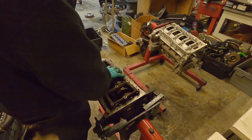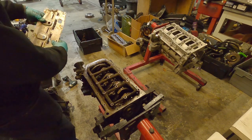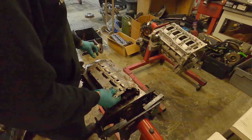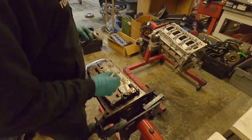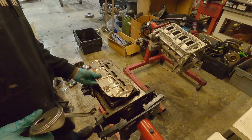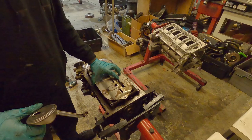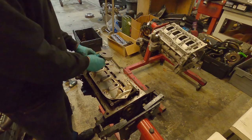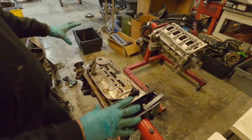There are several bits to put on now: the crank girdle which ties all the main caps to the block keeping them rigid, a windage tray, and the oil pickup. Some of these bolts go through more than one layer and some just don't. You might need to spend a bit of time positioning things to see how everything goes — for example, this one goes one way around. Work out which bolt holes are in the first layer, which bolts you need to leave out for the second layer, and in this case there's a few bolts that need to go to the third layer. Just get a visual of what you need to put in first and make sure you've got all the bolts you need.